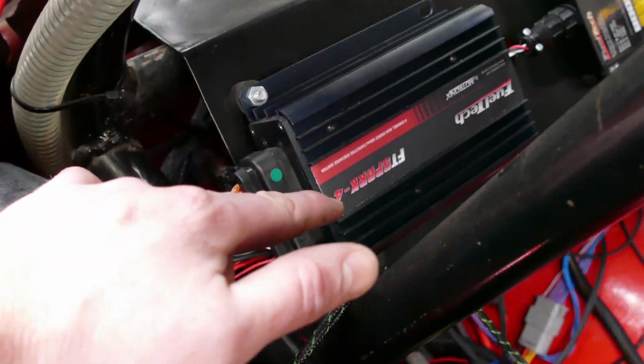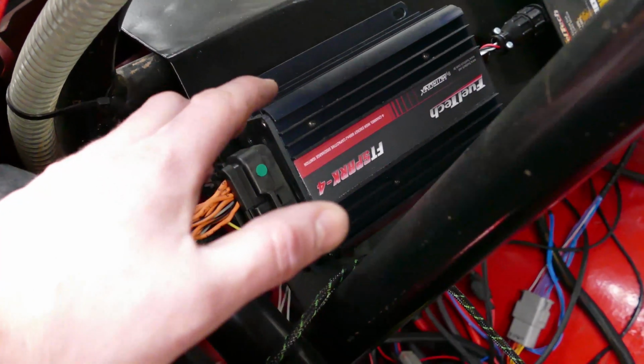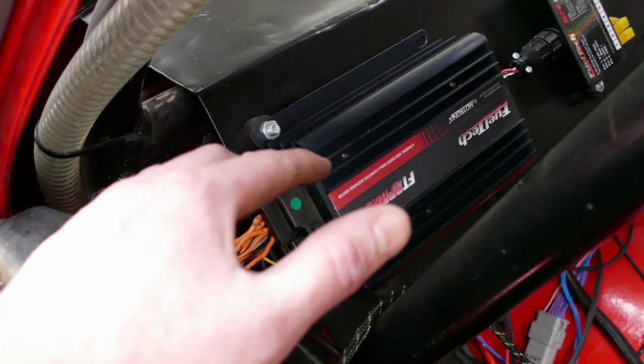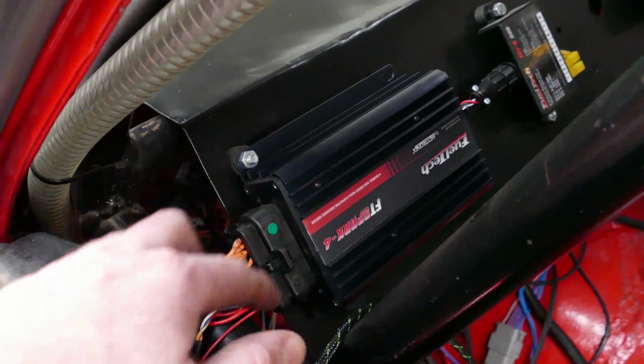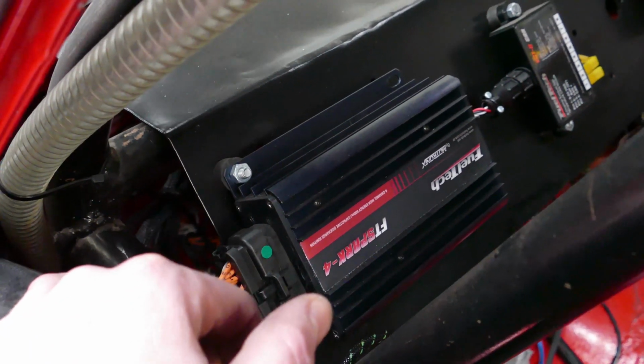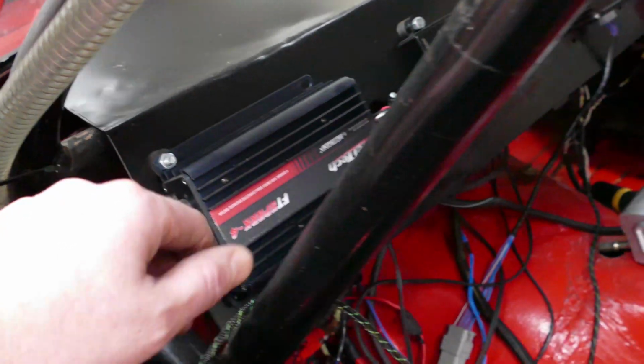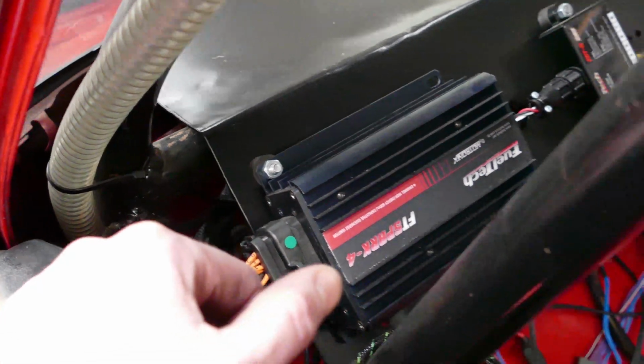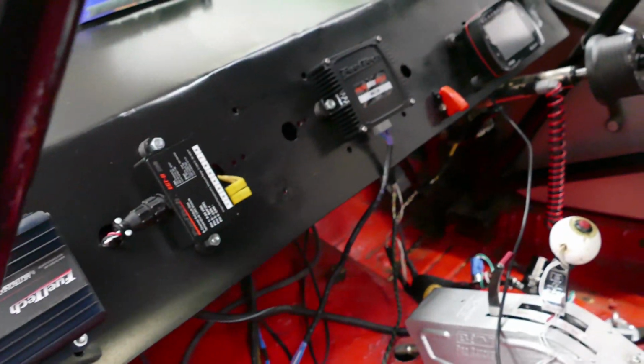Other thing we've got in here that I love is the FT Spark. This is the FT Spark 4 CDI unit. Just phenomenal. If you're running alcohol fuels or especially methanol with a rotary engine, that thing's mandatory. 600 millijoules of spark energy is off its head, so love that. Can notice a big difference going from the Ignition 1A coils to this with really rich mixtures.